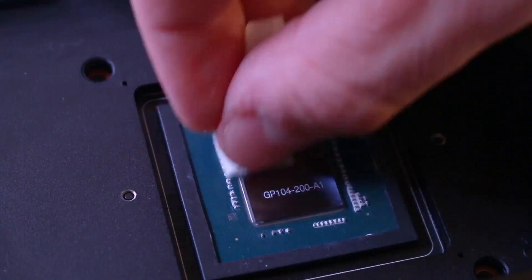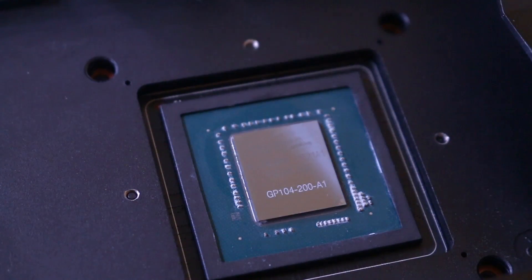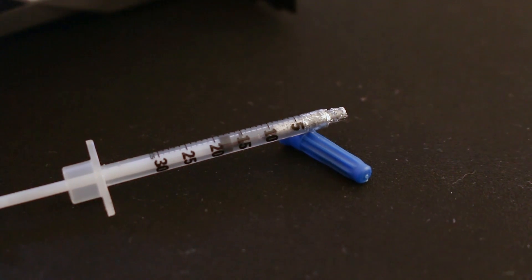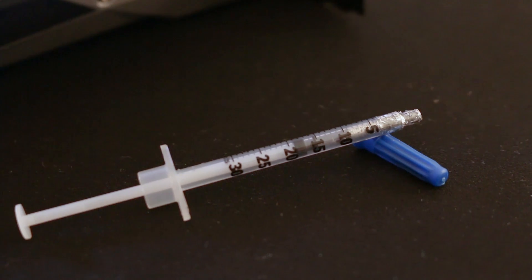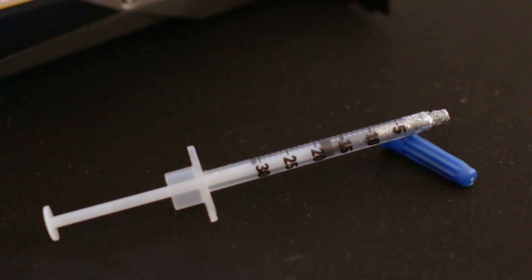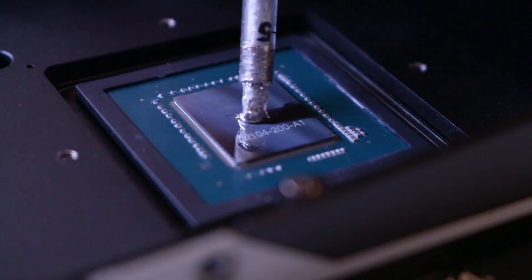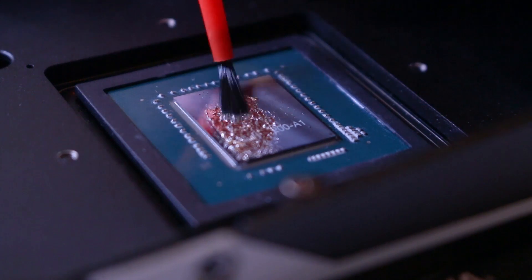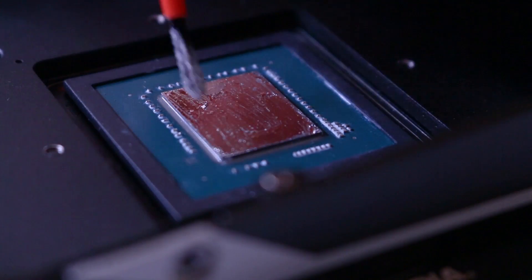For the die, don't worry about the remaining thermal paste between the surface mounted components, as the pitch between them is quite small, so it's best to just leave them alone. Now, time to apply the liquid metal to the GPU die. For reference, I'm using Cool Laboratories Liquid Ultra, which I still had left over from my 7700K delid. Seeing as the die and the heatsink are in direct contact, I made sure to apply an extremely thin layer as I didn't want it being smooshed out to the edges and touching those resistors. Liquid metal is conductive, so be extra careful when applying it.